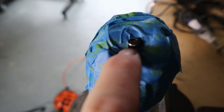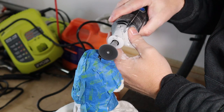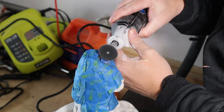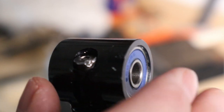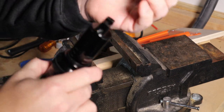I'm going to see if I can slice it and then take a punch and try to loosen the bolt. Instead of cutting across the top, I cut a vertical edge in it with a dremel, then took a chisel and hammer and gave it a good whack. It moved — so hopefully I can just twist it out. She's coming out slowly but surely, the head's pretty loose now, and there we go.